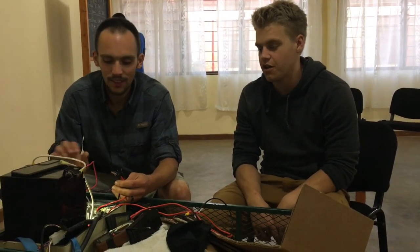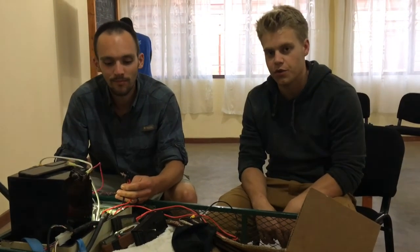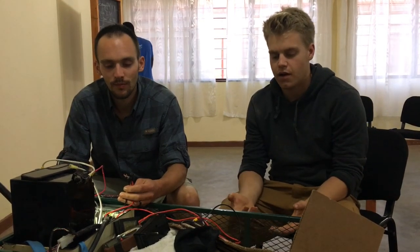Okay, so me and Teal have been working on the cart, trying to fix the problem we ran into with the community where it was just stopping once it started to take a load. And so we discovered it really is the charge controller. We were adjusting these tiny, tiny little pins, just like I said, to connect in the booklet, and it wasn't acting like I said it would act, we were still having the same issue we ran into with the community. So we basically were deciding that we're going to bypass this extra layer of complexity, because if we can't predict the performance of the controller, we can't predict the sustainability of the cart.